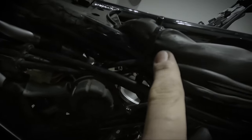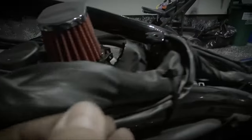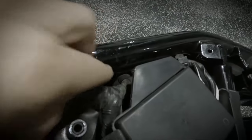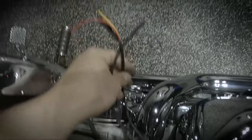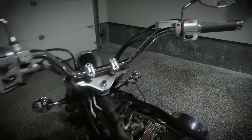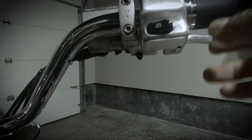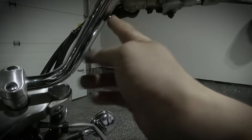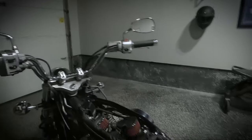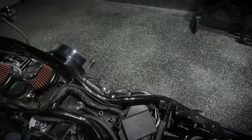I plugged the cable back into its original spot and ran the cables into the existing zip ties — the two cables follow the frame on this side, tucked in nicely up top and then down below, with plenty of slack to wire in the two buttons. Let's close up the front section, clip it to the existing clips, and hook it up to the brake so the brake signal still works.